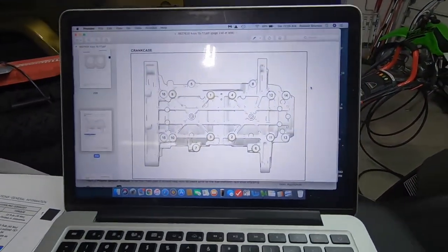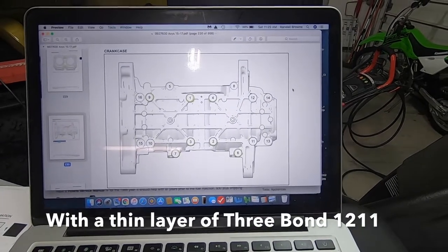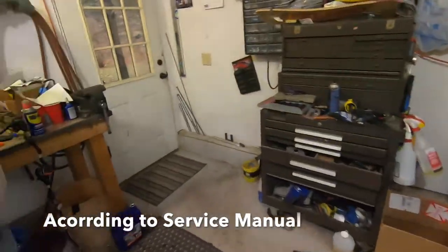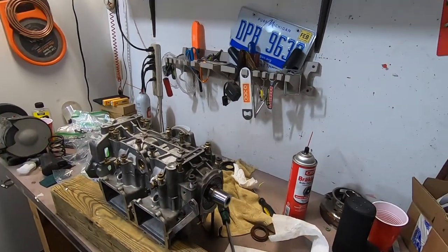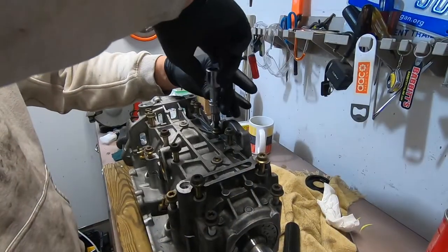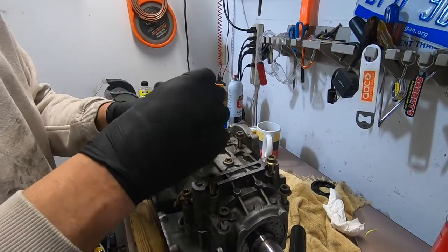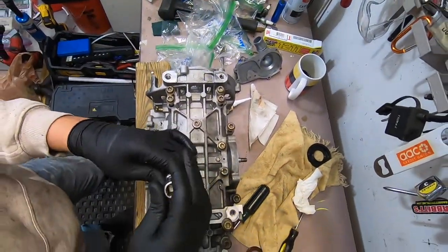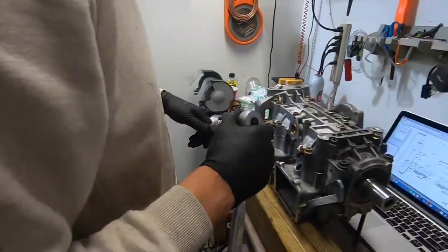So guys, we put the crankcase back together. We just need to screw it down to this spec. So over here, we're working on it. We're putting all the bolts in. Just gonna screw them down in order. Some people might use a driver here, but I wanna make sure I torque them evenly, so I'm just going down by hand. Put a touch of pressure on each one.